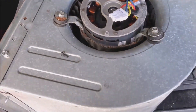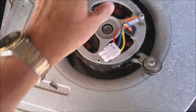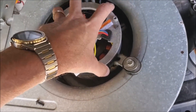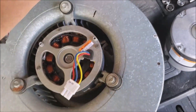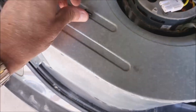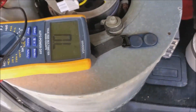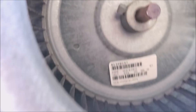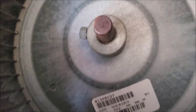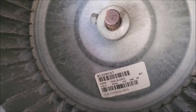I think there might be an issue with this motor, so I'm going to take it out and replace the whole assembly. To do that I need to turn this around and loosen the squirrel cage. I seem to have lost a couple of screws — got a little magnetic strap on here and they just picked them right up. I'm going to flip this over, loosen that set screw, and mark this shaft with a sharpie so I can measure how far in the squirrel cage goes when I attach the new one.